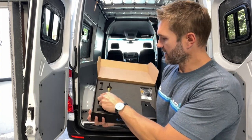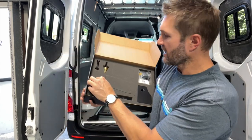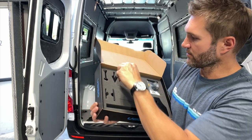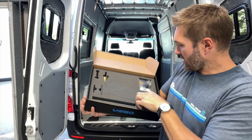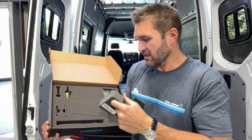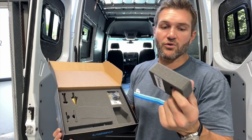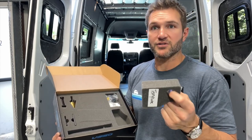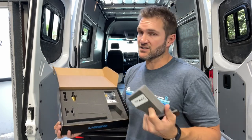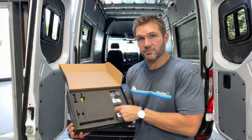Item number one is making sure you have all the stuff in your kit. We've got inner hinge brackets, and we include a step bit — this is for widening the hole that you drill through the door. This is the actual door plate. Keep this below it: the template. This template is going to be important for marking our door, and we allow for a fair margin of error, so when you draw that circle and drill that hole in your van, it's really simple.